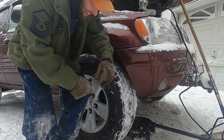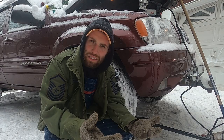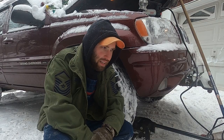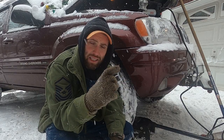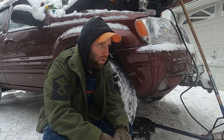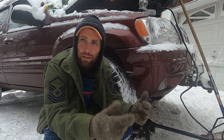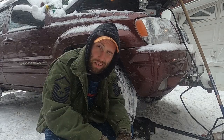So there is to it, friends. It's not pretty, and certainly wouldn't have been granddad approved, but in a pinch — or if you have a vehicle like this where you don't need to spend $1,200 on a lift kit — even those budget pucks, I'd rather do this. Because all those do is add some height to my already worn-out 20-year-old springs. This simulates a better spring rate. For plowing, I'm about to put a 500–800 pound plow on the front, and it's going to be wanting to pull that body down into these way oversized tires.